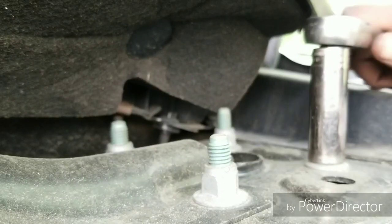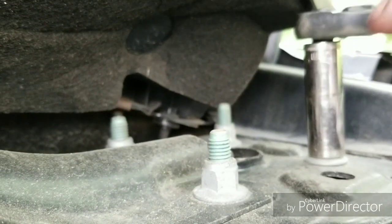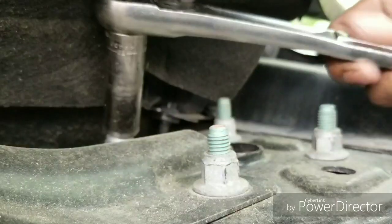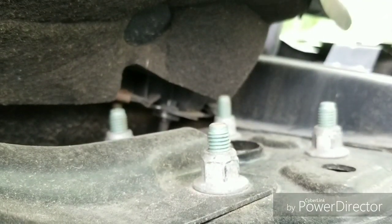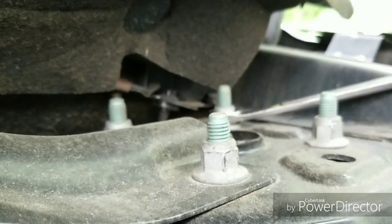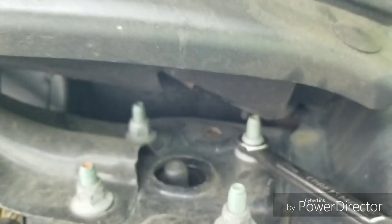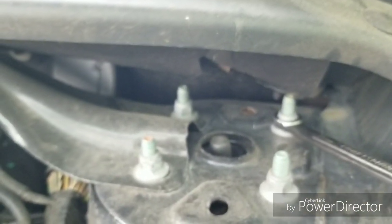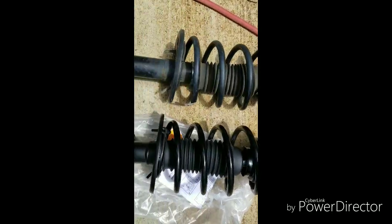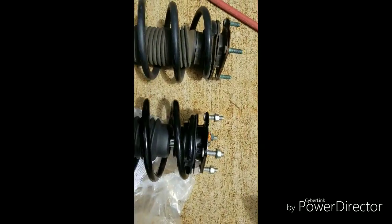Just like that — kind of tight, but that's all you do. Just like that. They're a little tight; it's kind of hard to get the back one, that's why I got the 15s back here so you can get them easier. Once you get those, you take out basically the rotor part, take that out, and the strut will come right on up. You know you're going to want to make sure that everything lines up the same as the old strut, which it does. And it even comes with new hardware, new nuts — so you can throw all the old ones away.